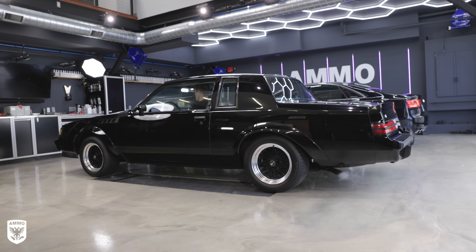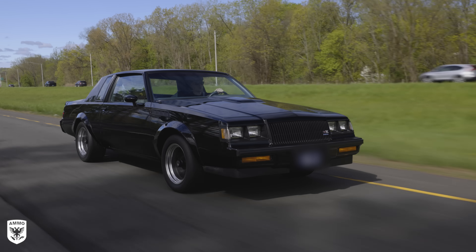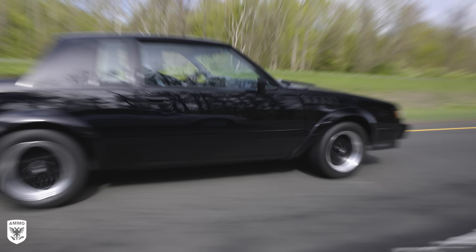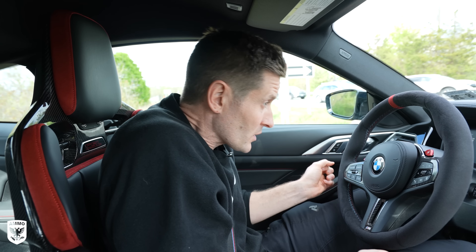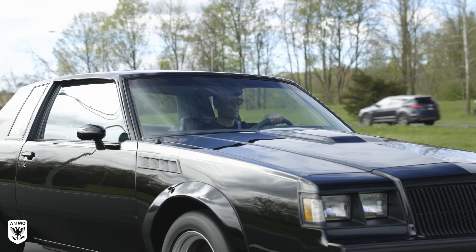Finally, I cleaned up the glass with some Obey. Glass is probably the thing people forget about the most, and it has the largest impact when you're finishing a car — you've got to focus on the glass. I added Mud to the tires, then pulled her outside in the sun to walk around and see the finished product. Get down on your knees, stand on your tippy toes, change the angle so you can see where the coating did or didn't adhere, any high spots or smudges. That's the time to see it before the customer comes.